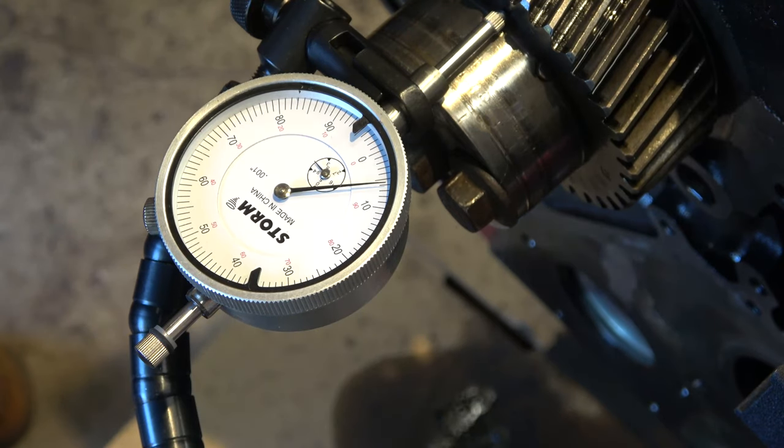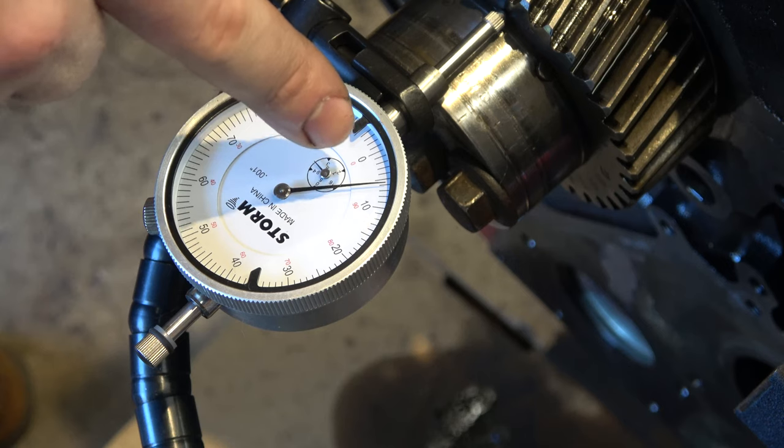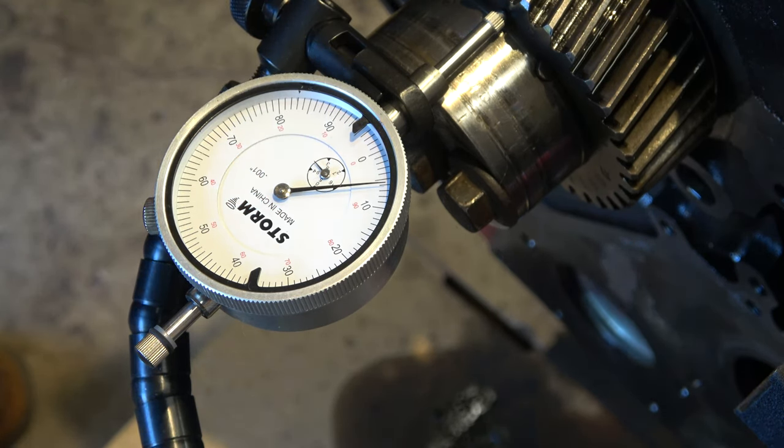It's loading. I gotta pull this manual up. Okay, took me a little bit, and of course, when I flip my phone around, it takes me back to the last page. Okay, crankshaft end clearance. The minimum is 4,000ths. The maximum is 17,000ths, and as you can see, we're just a skosh past 6,000, so we're within spec.